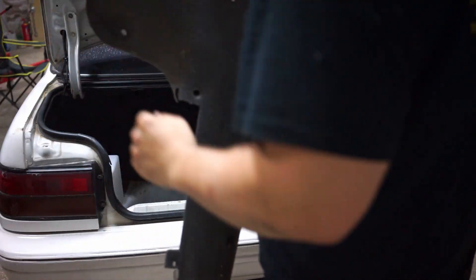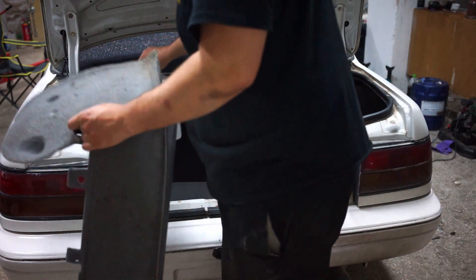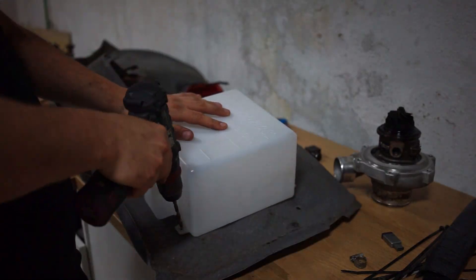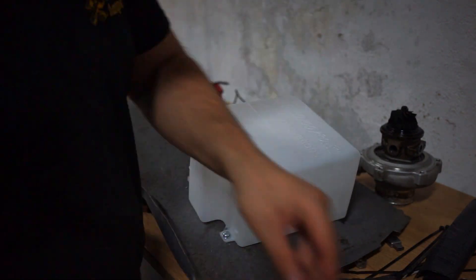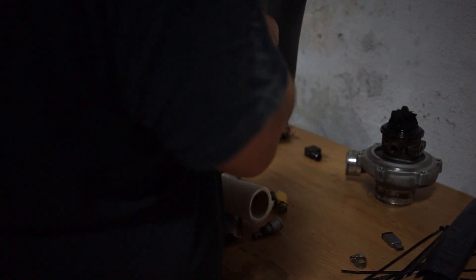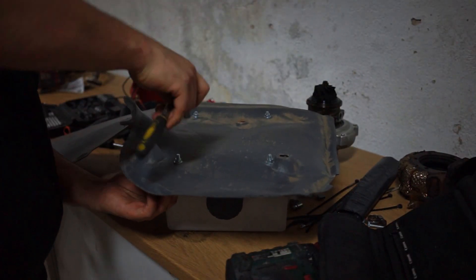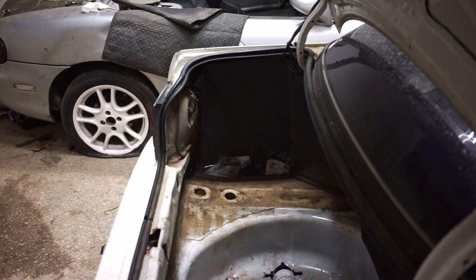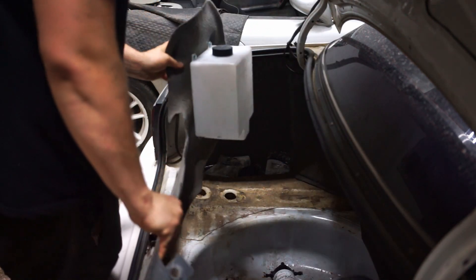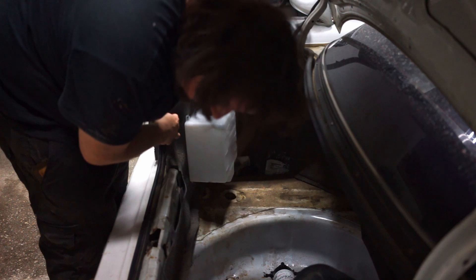First of all I'm going to install the tank for the water-meth injection. I'm going to do this on this piece of carpeting. It's solid enough to mount the tank because it is actually bolted down so it is not going anywhere — it really is a solid mount. It's important to mount the tank above the pump because the water-meth will flow downwards and the pump needs to be gravity-fed, as it won't suck the water-meth directly out of the tank if it were above it. So make sure that the tank outlet is placed above the pump itself. As you can see here, it is mounted on the rear of the car at a relatively high position, and yes, this is a sturdy mount so it is going nowhere even in a hard maneuver or in a crash.